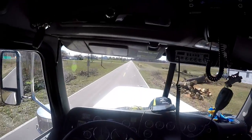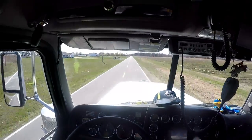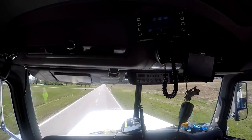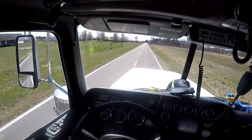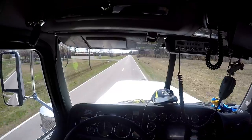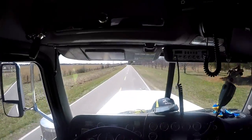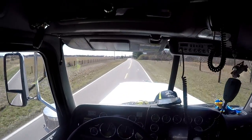Now I guess we'll try to find out what's wrong with picking up the truck. Do you need me to pick the bed and dump the rock, or do you want to just wait? No, we'll just wait. I don't think it's nothing major. It could be out of fuel. I put 40 gallons in it before I left, and I only made 2 trips. I thought maybe it gelled, but then you said the temperature wasn't that cold. It says 35 now. It's acting like some relay or sensor that's just not telling it to throw fuel at it. When it died, it didn't sputter and spit like it was running out of fuel. It just quit. I was pulling that hill right there with the cruise set at 65, and got halfway up the hill, and all of a sudden, it just quit.